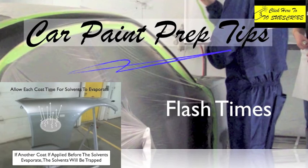If you just put one coat on top of another, you're going to trap those solvents in there, and they're going to come out eventually. But when they do, it may cause different types of problems. It may cause adhesion problems, solvent popping, a lot of different things. So be sure to look at your P pages or technical data sheet for the product you're using, and allow the proper time for flash.